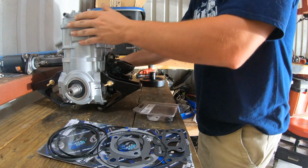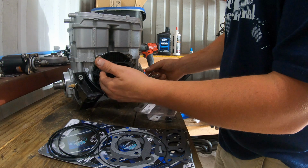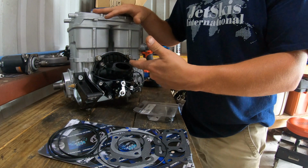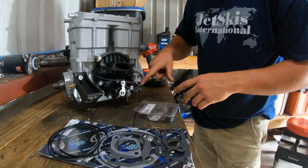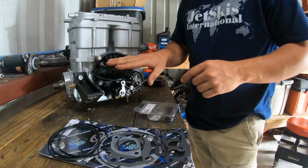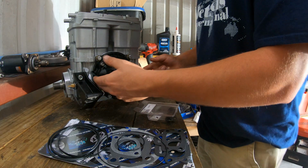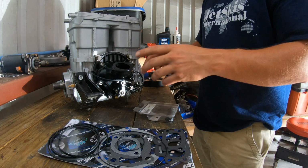Okay, so I did put everything back on, and then your oil pump, I just wanted to make sure that it was working. So these lines were off, the oil injection lines were off, and I took my impact with a 10 on the sprocket internally, that draws off the drive gear inside the motor itself. I started turning it, and I put my thumb right here, because this is the suction. This is where your oil line is coming from the tank. So it's causing a suction, and it's going to build up pressure, and it's going to inject it inside the case. I wanted to make sure that oil was going to feed through. So I put my impact on it, rotating it, and I put my thumb on it to see if I could feel a vacuum. And then actually, the old oil in it, I can see it starting to pump out the lines. So I was like, well, all right, I can see that it is working, because it doesn't need much.